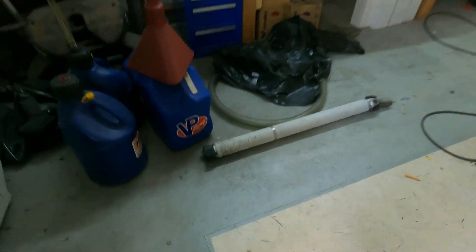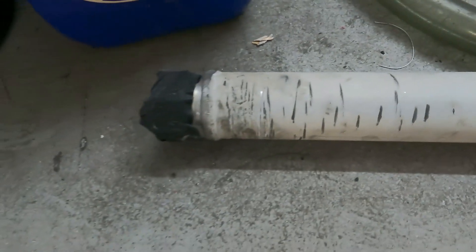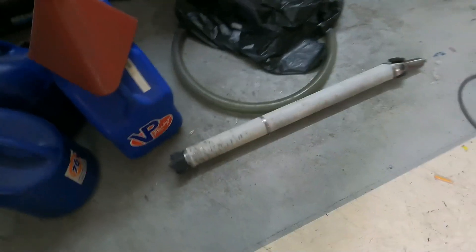One last thing — we need to find out if that driveshaft is going to be okay, where the panhard bar chewed on it. It should be okay though. It ain't like it took a big chunk out of it or nothing. The only reason it might be an issue is it may have tweaked it just a little bit. Barely bending a driveshaft will become a big issue the faster you go. If you have a bent driveshaft trying to go 90 to 100 miles an hour, it's going to rattle your brains out. So we'll go make sure it's right, get it put back in here, and then we'll be ready to set up and take it to the racetrack.